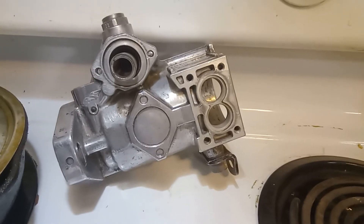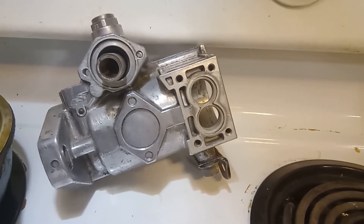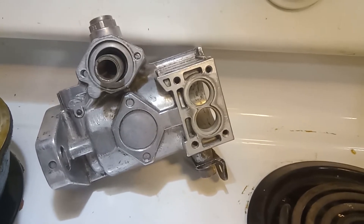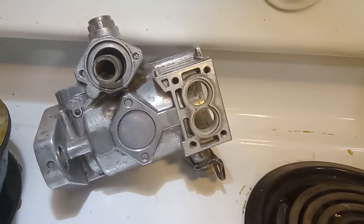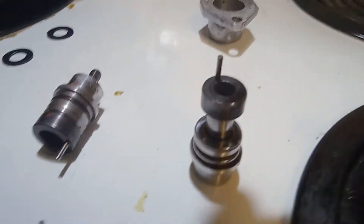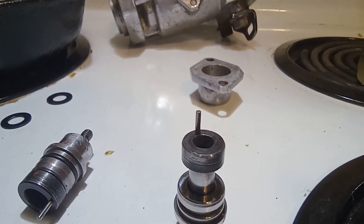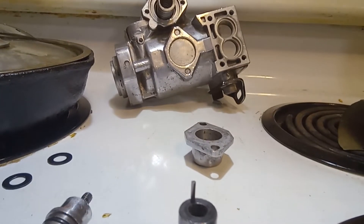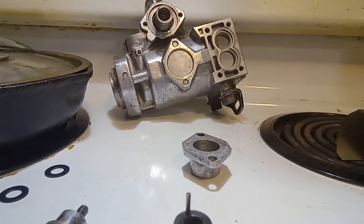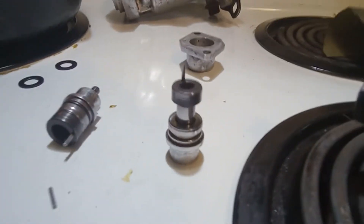The reason I had to remove it — see the two holes on the right? The throttle valve was leaking, and so was the shutoff valve, the one below it. See that pin there? Those snap off. The throttle gets so stiff, or the shutoff — one or the other — will get so stiff, usually the shutoff, that it snaps the pin off.